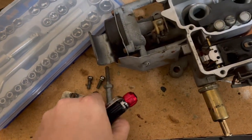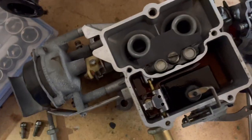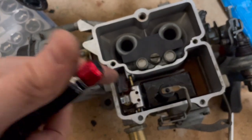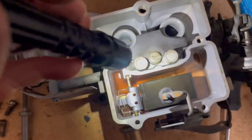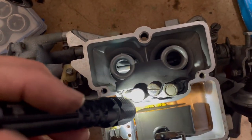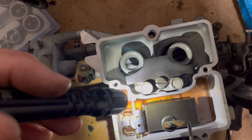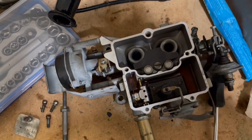Four screws later, plus the threaded item for the air cleaner — which was a half inch on this car, not three-eighths like the four-barrels — and the air horn is off. You can see inside the carburetor: there's the float, the accelerator pump vent, and the needle and seat. To get the float out, pry the little clip out of the way and the float and needle come out with it. If you've got a mid-70s Ford, there are two jets you can take out with a big screwdriver — they'll be numbered. I recommend going up about four numbers in jet size; order them online or on eBay and your car will run a lot better. These late-60s ones are generally just fine.